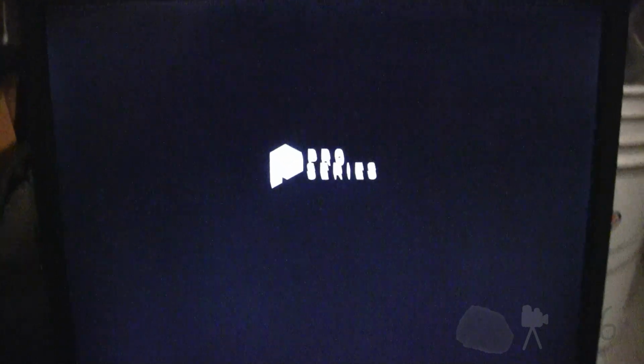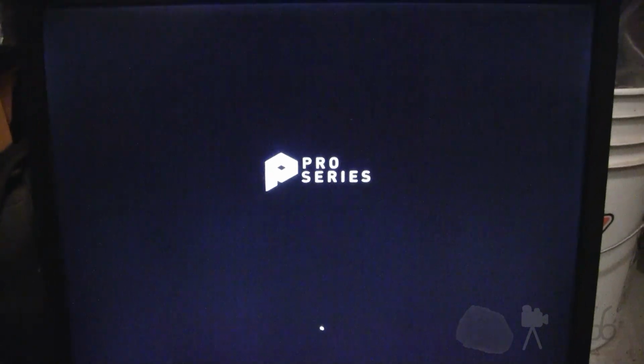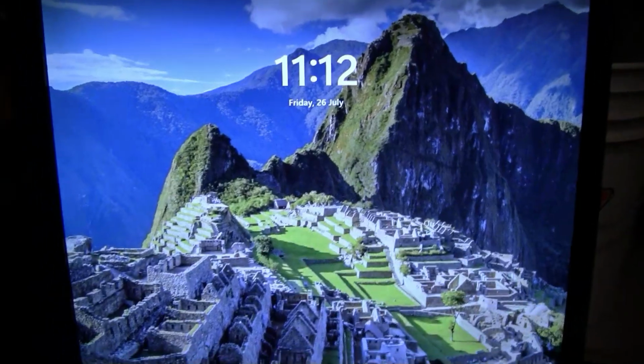I'm definitely having some video problems with this though. The display keeps turning on and off. Reboot it again. We're out of focus. It could be a memory incompatibility because I'm using the onboard video. In fact, honestly, that's probably exactly what it is. It means I'll have to blow yet more money on a 64 gigabyte memory kit, which maybe I should do in the first place.